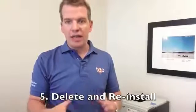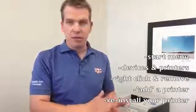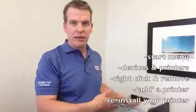That's your printer troubleshooting 101. Now I'll give you one more slightly more advanced option. If you're feeling confident, you can try deleting and re-adding your printer. A lot of times this will fix the issue. If you've tried the four basic steps and they haven't worked, go to your Windows 7 Start menu, open Devices and Printers, find your printer, right-click and remove it. Then towards the top of the screen you'll see an Add button — add that printer back, pick your printer (I'd pick the HP), then give it a try again and see if that works.